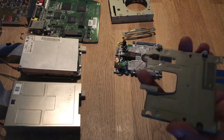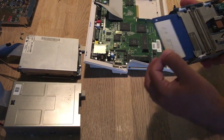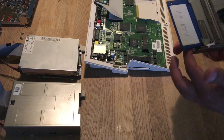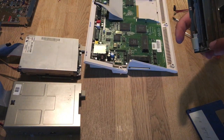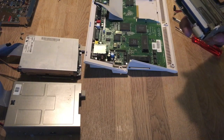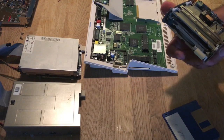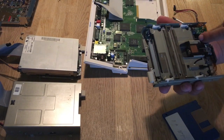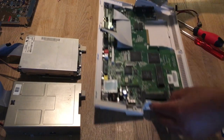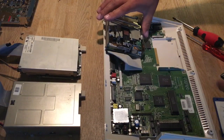Let's check it - feels nice, this is how it should be. The main problem was cleaning inside and the bent metal part. The disk drive is alright now. I've also cleaned the head as I showed before. The only thing left is getting some grease on there and then it should be alright. The cable goes in here and the power cable here - let's reassemble it and test it out.